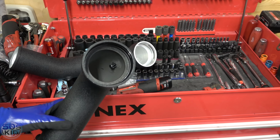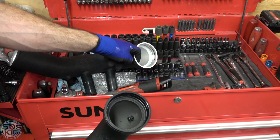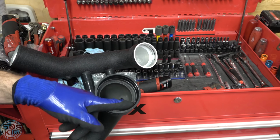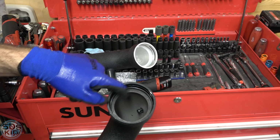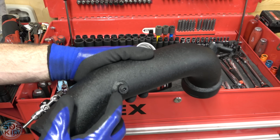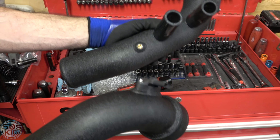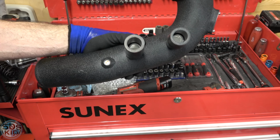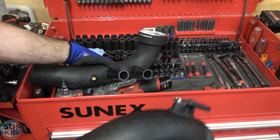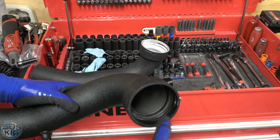And here's the difference between the eBay one and the BMS one. You see the BMS one is aluminum on the inside. This one, they powder coated the whole inside. That's probably where my difficulty is. You can see that they screwed the bungs for the methanol injection in. They powder coated over that. This one, they removed it before they did the powder coating and they chased the threads. It's just faster for them to do it this way. And I think that's where all my problems are.